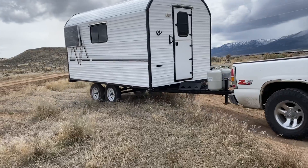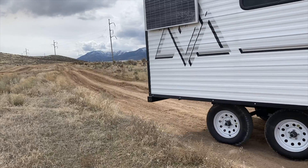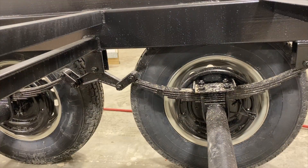The other option is under-sprung. The next camp I'm building will be under-sprung because it will be doing a lot of highway traveling. Getting the center of gravity down on the camp makes it a little more stable. You lose some ground clearance, but if you're not planning on using it off-road, that doesn't affect you.